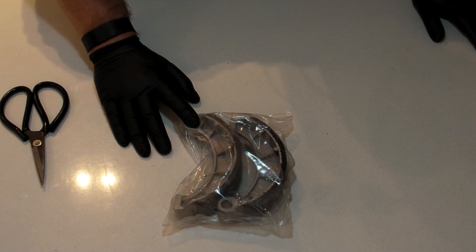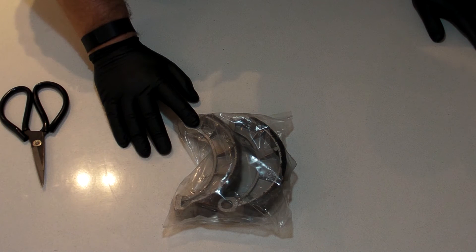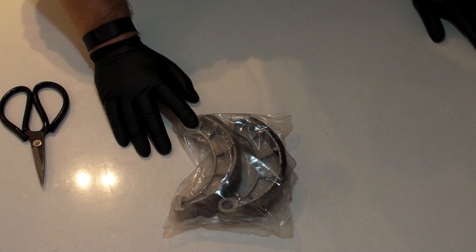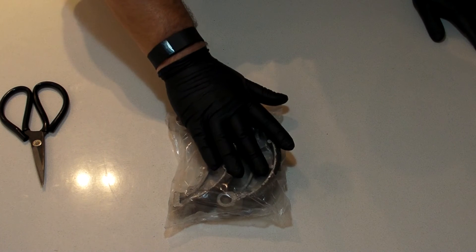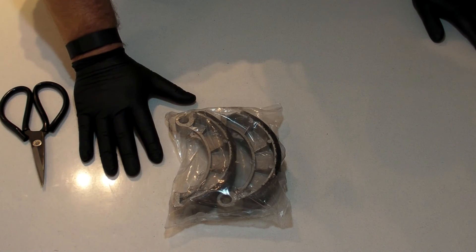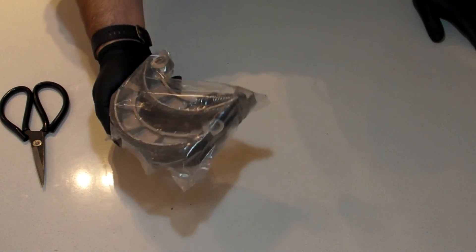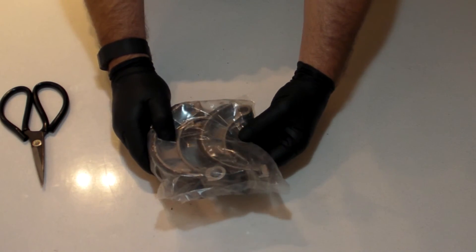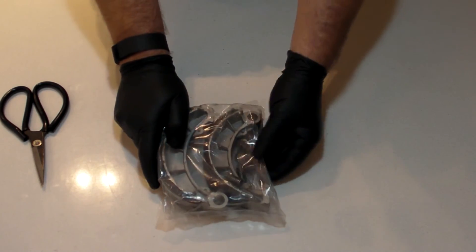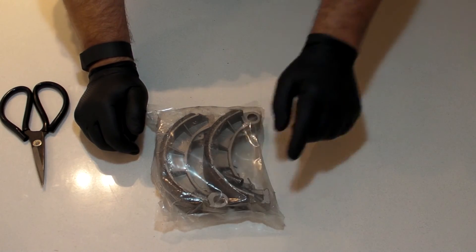The existing one actually looked like it had maybe 50% wear left, but seeing as I was opening up the rear completely I figured I would replace the rear brake shoes — partly for the experience of having done it and partly from an abundance of caution. This kit comes with the springs, so it's pretty easy to install. You hook up the springs, tension and twist them together, and then drop the two ends on the pins. It has to be greased up correctly.